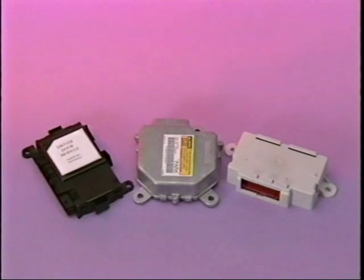For example, in the event of a collision, the RFA will pick up a deploy message from the Class II system that the SDM has deployed an airbag, and that the RFA should wait 15 seconds and command the doors to unlock. This is made possible due to the sharing of information between the electronic modules on the vehicle. This is just one example of how the Class II electrical architecture makes the 1997 Park Avenue more efficient.